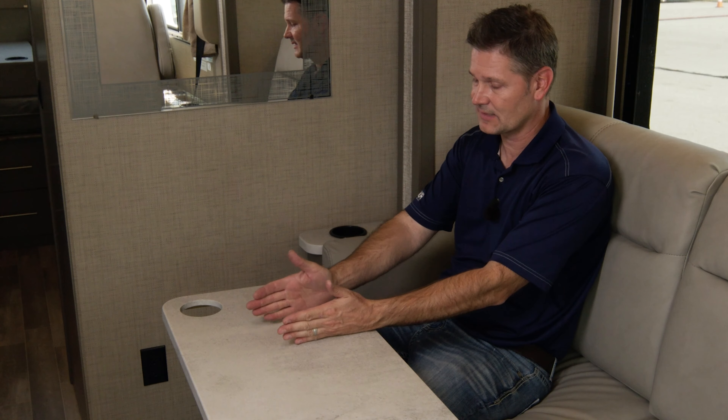Let's talk about the refrigerator. It has a great smart feature — you can choose auto or gas mode. If you want to run strictly on propane, choose gas. I would recommend auto, because it will automatically change from gas to electric when you're plugged in. If you're dry camping somewhere you can't run your generator, it will run off your propane. When you are plugged in, it will run off electric. Set it to auto and you have your freezer up above and your fridge down below. Temperature control is right over there.